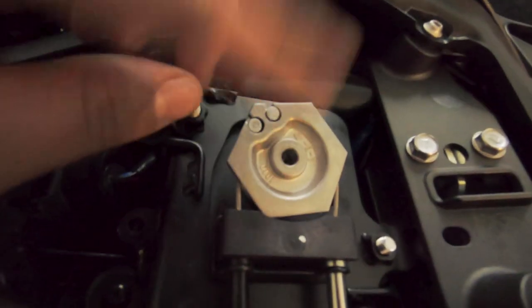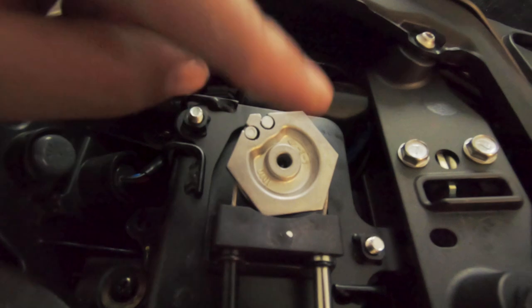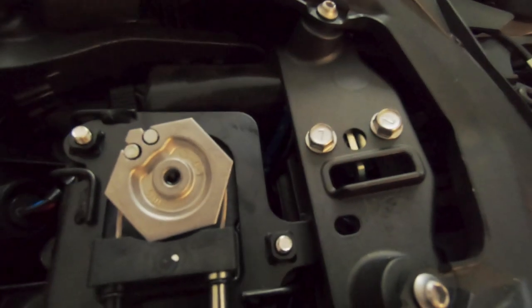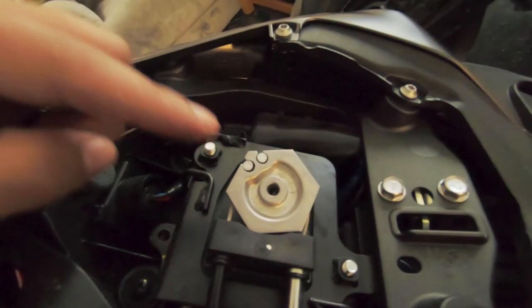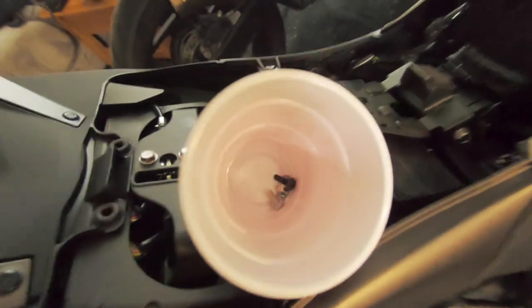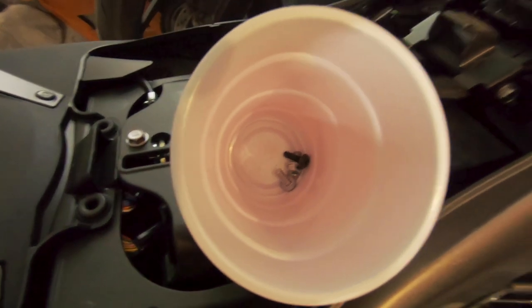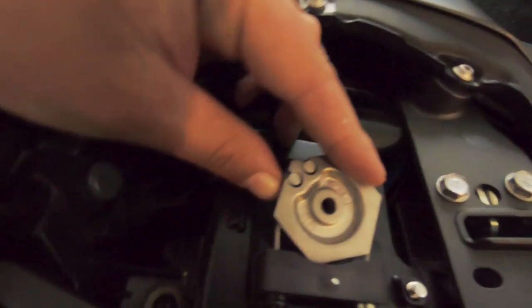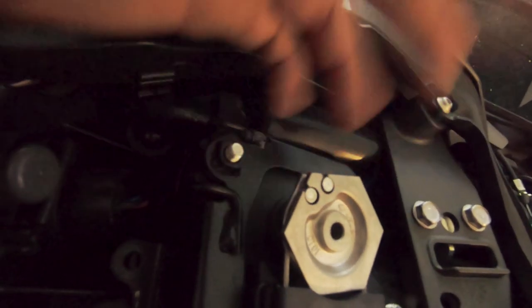Update for y'all — this bit right here was a T27 torx bit with the tamper, so it has the hole in the middle for the tamper part of it. I would actually recommend taking that off before you take the 10mm off; it just makes it easier to remove, but if you didn't, it's not the end of the world. A tip I have for working on anything where you're removing hardware — I use solo cups to separate everything, so this is all from the servo motor. Most of this is going to go back on it since I am saving the servo motor in case I ever have to go stock. Now that you have this off, once you remove that screw, you can lift this up and get the slack on the cable. You just have to pull this cable up where it'll fit in that slot, lift up, and pull it out — do that for both sides.